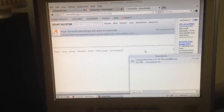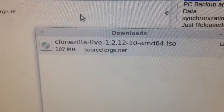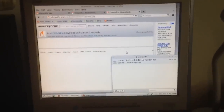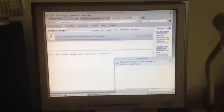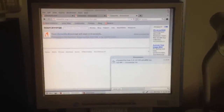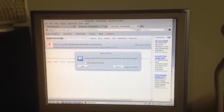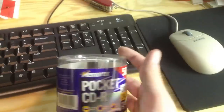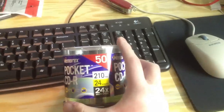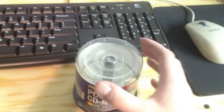The first thing I did was download Clonezilla from the website, and I'm going to use that to move the data on the 40 gig hard drive in the server over to the 40 gigabyte SSD. It's perfect because it's an exact size match, so it won't be too much trouble — I can just clone it and that'll be it. I have some Memorex Pocket CD-Rs here, and Clonezilla will fit on one of these because of the size. So let's burn a tiny CD, shall we?